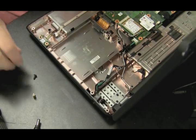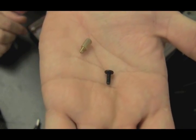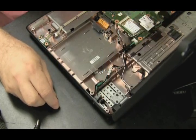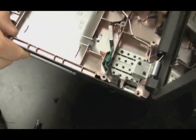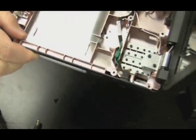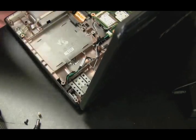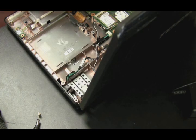Here's the solution I came up with: we're going to use a black screw which will screw into the bottom of the laptop through a hole, and attach to a standoff that you would use on a motherboard. That standoff is going to be a post that holds the jack into place. I'm going to put it right up against the back of the jack, drill a hole directly under where that standoff is, and screw the black screw through the bottom of the laptop into the standoff. I'm using a black screw for aesthetic reasons so it doesn't stand out on the underside of the laptop.